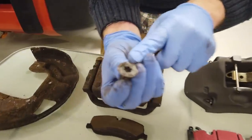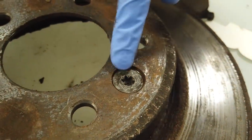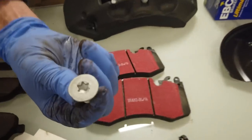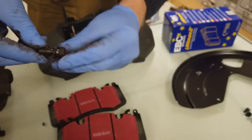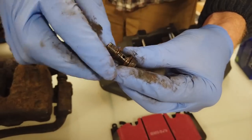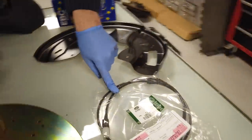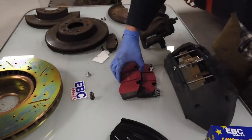Other little bits: these Torx screws hold the disc on. We're going to supply this kit on the website - always put a new one on. It's the hydraulic fitting and the two copper washers; we'll try and add those to the kit. We're also going to throw in some new bolts for bolting the back plate on. And you will need a new wear pad sensor - I'll show you how that clips on.